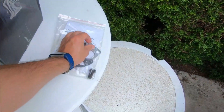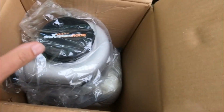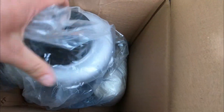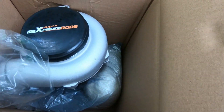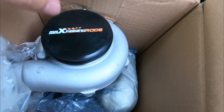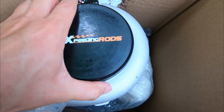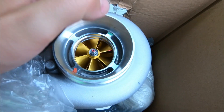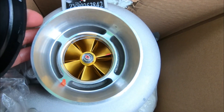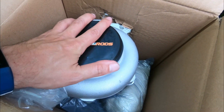The kit does come with an oil feed restrictor, which is really nice. Sometimes on journal bearings you still need an oil restrictor to reduce smoking of the turbo based on my experience. Here it is — the GT3037. This is not your average turbo; you're not going to be putting this on a stock vehicle. You really need a built engine or something that can withstand up to 500 horsepower, which this turbo is rated for.